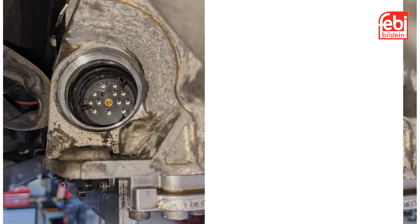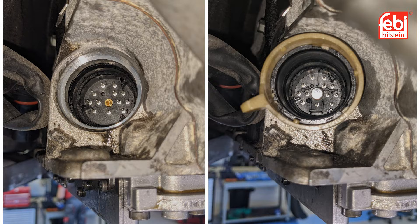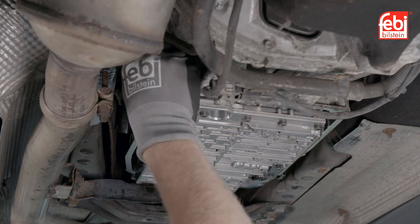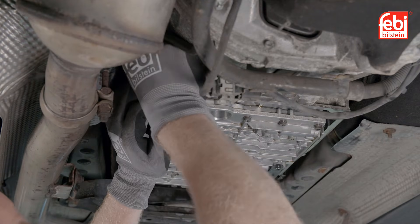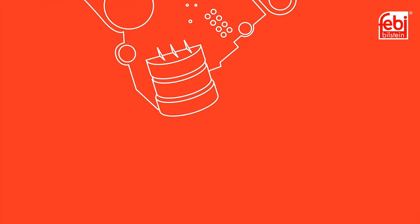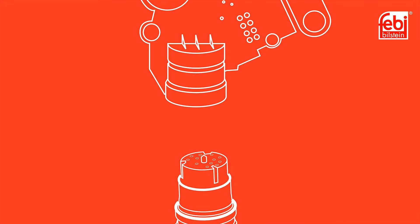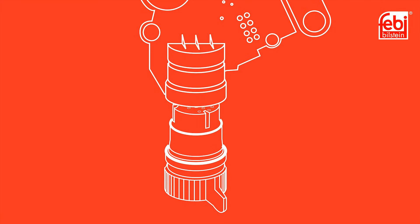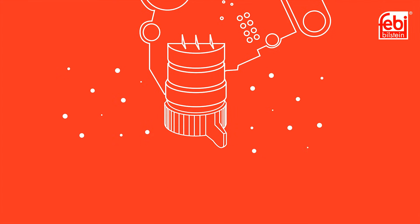Lubricate the new electrical plug connector O-rings and align the holes in the guide bush with the pins in the conductor plate. Then push into place and tighten the retaining bolt. The conductor plate is connected to the wiring harness of the transmission by this connector, which is sealed inside the conductor plate and the transmission casing O-rings. A failure of these seals allows oil to enter the harness plug, where metal contaminants suspended in the oil can cause short circuits.